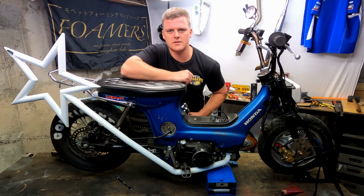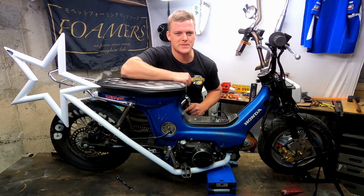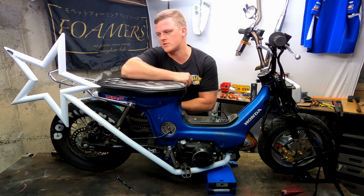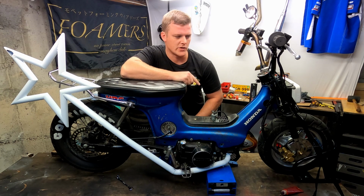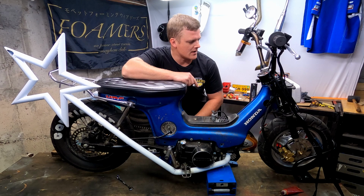Well, that was probably a good idea I did that. Both engine mounts are quite loose, the swing arm was loose, both hardtail mounts, which are probably the top and bottom shock mounts. It has been ridden a lot, and there was a lot of Loctite thrown onto this thing before it started to get used, and it's just had a lot of use. So yeah, now it's doing alright.